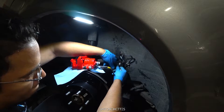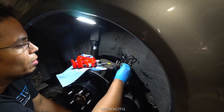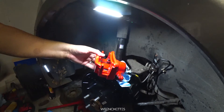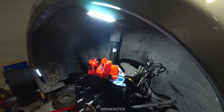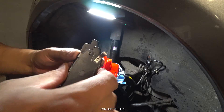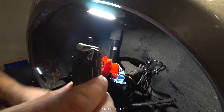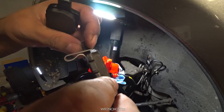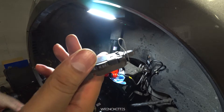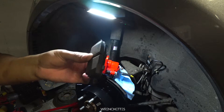I'm going to put the clip back in. Clips are in. If you don't know how they go, the best advice is to go back to the old one and see how they're seated. These two brake pads — one has a little thing right here, this is the wear indicator. So if you wear it up to here, it's going to start squeaking, giving you a little heads up that your brakes need to be changed. The one with the indicator goes on the inside; the one without the indicator goes on the outside.